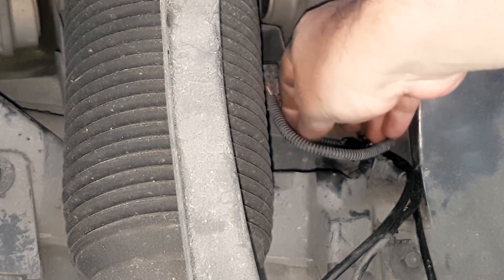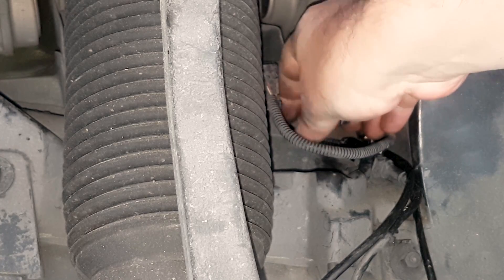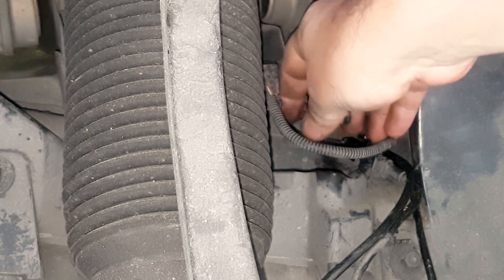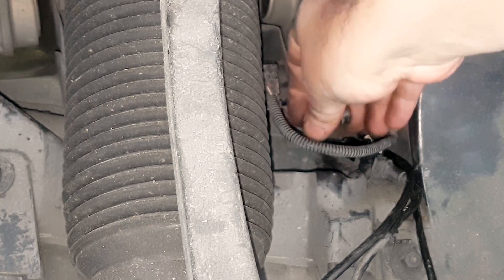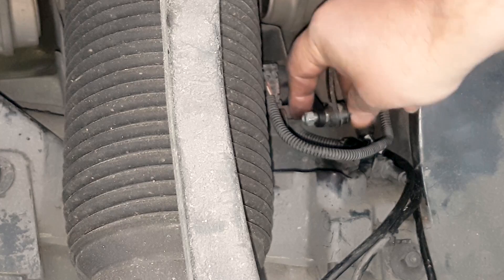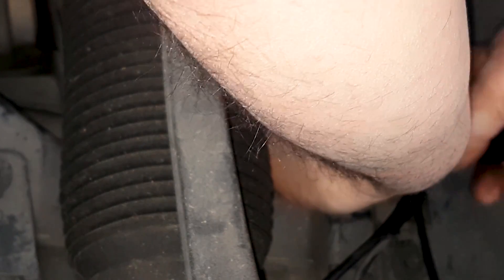You have very little room here to work to get the sensor out. I'm not saying you cannot remove and reinstall the sensor without undoing this bracket, but if you do undo it — using a ratcheting wrench or regular wrench and a 10 millimeter — it will take a little longer. You'll also need needle nose pliers for the two handles connected by this 10 millimeter bolt.